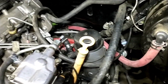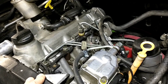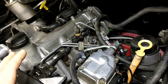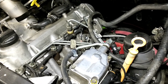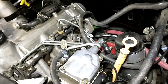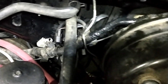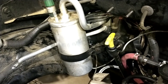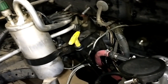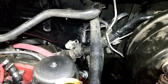The next thing I wanted to go over was your factory wiring. A lot of people are trying to make a connected harness - put the swap vehicle's harness into the Volkswagen harness. For me personally, I just like leaving everything separate. As you can see, the factory wiring is still laying there and I've got it tucked up over there for right now. I'm just going to make sure I don't need any other sensors or plugs before I cut everything off and clean it up, then I can get those extra plugs cut off and just isolate all the wiring.